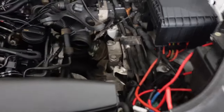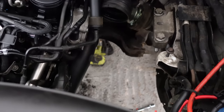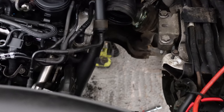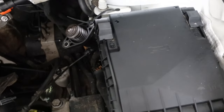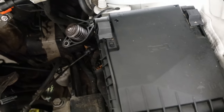Quite a few things really, drop the gearbox. Once upon a time, a job like this would have scared me right off, but I think I'm at a point now where a clutch change doesn't really faze me. Did notice as well the slave cylinder is a little bit sticky. Can't see any leaking, but for the sake of 40 quid, we might just replace it.